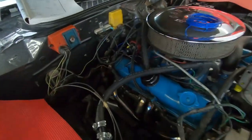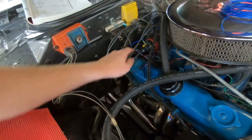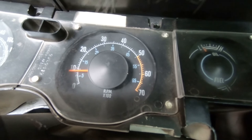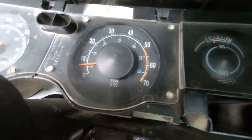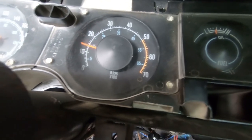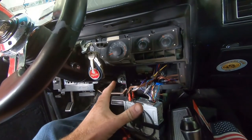After a whole lot of standing on our heads underneath the dash of this car, we finally got the tach working. We've got the signal coming off the coil. Now comes the job of putting everything back together. This means we are ready for the dyno test on Saturday and we don't have to worry about using that aftermarket unit - we'll save that for the old grandma.